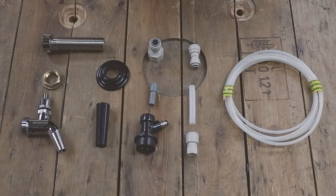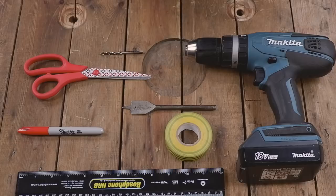We've got a selection of parts to put together a kegerator: a long shank, an Intertap tap, a slender tap handle, a John Guest 3/8 to 5/8 adapter which goes onto the back of the tap shank, a 3/8 to 3/16 line reducer, a 3/8 stem to 3/16 push-fit reducer, a liquid out post CMB, and a John Guest quarter FFL female to 3/8 line adapter. We also have about 3 metres of 3/16 line which you can cut back to get your flow running correctly, and a small section of 3/8 line.